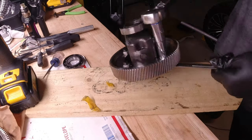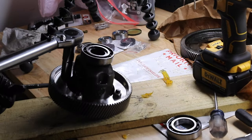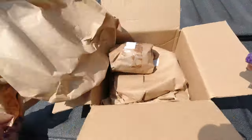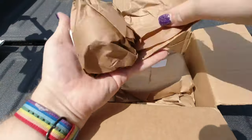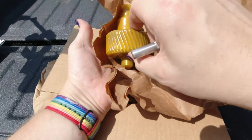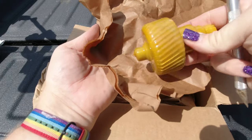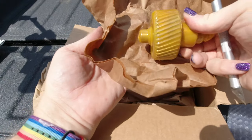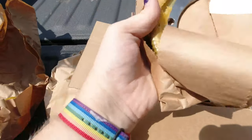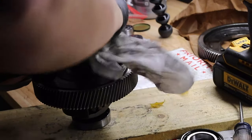These EZ-GO golf cart high-speed gears are for 1988 and up electric and two-cycle motors. The 6-1 ratio is the fastest gear set you can buy - these gears will lower the amount of torque you used to have simply because of the ratio. A lot of the gears come from Apache Gears in Arizona, but I ordered these through Amazon and I'll throw a link in the description. The gears come in 6-1, 8-1, and 15-1 if you decide you want more torque. The bulk of the driving we do is on flat surfaces, so torque and hills aren't necessarily a problem and speed was the biggest concern.